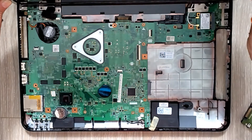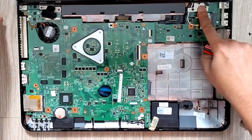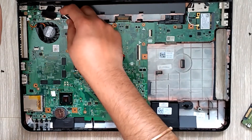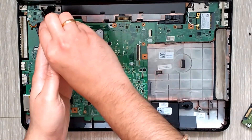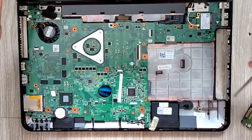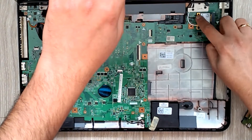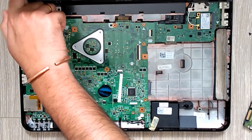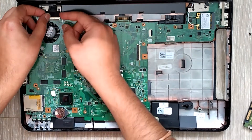The display can now be put back. An interesting thing I found after assembling it: the Wi-Fi seemed to not work. I have a dual boot system - it worked on Windows 7 but not on Windows 10. I had to enable it using a physical function key on the keyboard to enable the Wi-Fi. It was somehow turned off, and once I enabled it the Wi-Fi started working.